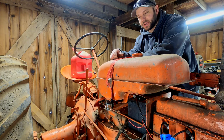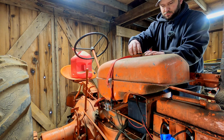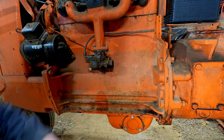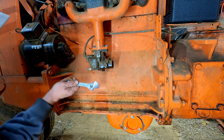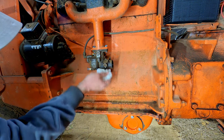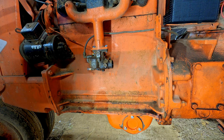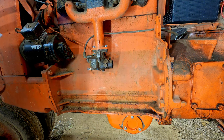Time's come. We'll put a little bit of fuel in the tank and see if our fuel system's got any leaks. Well, I'd say we have a leak — I'm guessing the float's not floating. I gave the carburetor a couple of taps, and it seems to have reset the float and needle. It's still dripping a little bit, but I think that's just because there's so much fuel in here now. Hopefully that won't cause an issue.